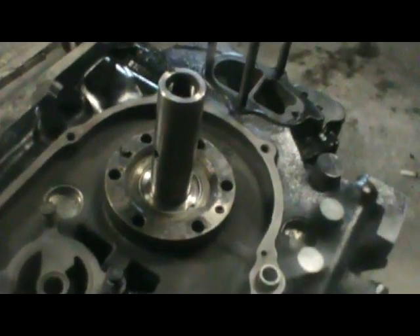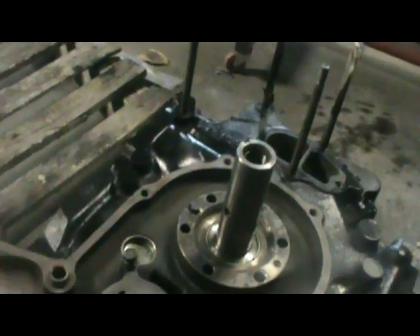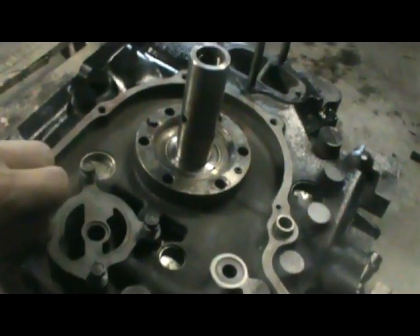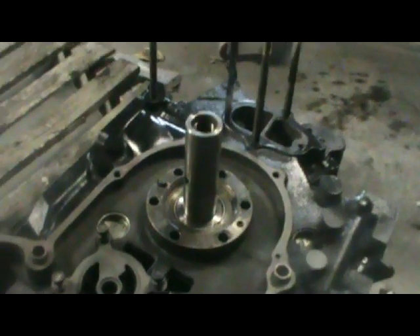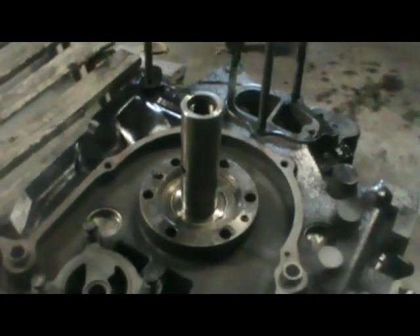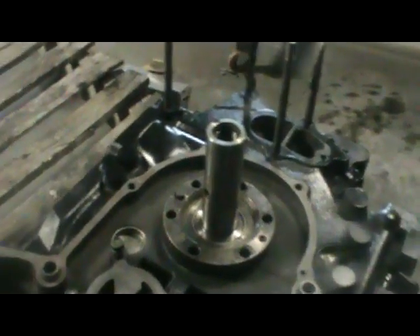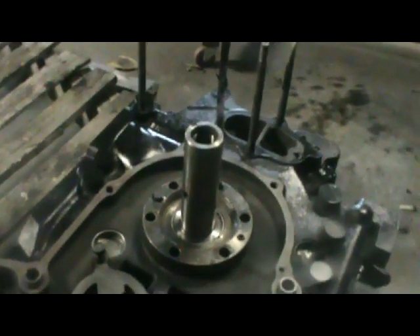And I have a new thermal pellet that replaces the little thing that goes in the end of the crankshaft. It'll end up giving better oil pressure when it's still cold. Before, there was a little thermostat thing in there that opens and closes — when it's cold it cuts the oil feeds to the rotors, just to warm the rotor faces up. It was for emissions, but it results in really low oil pressure like you can see in some of my old videos.